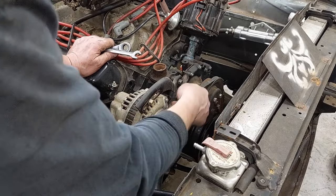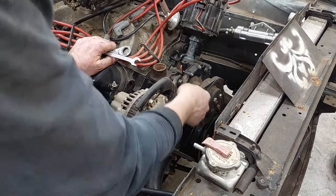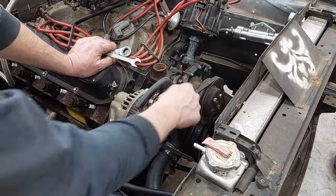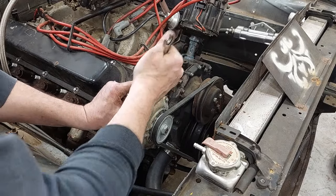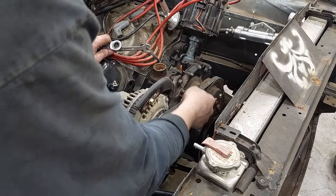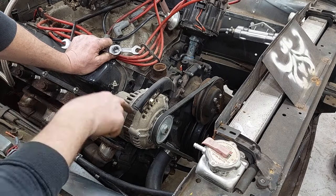It's a little more snug than I like, but the belt turns pretty easy. If you get it too tight you're gonna have a harder time twisting the belt. Being as far out as it is, I may go a little bit looser. Also, if it's a brand new belt it's gonna stretch a little bit. This is not a brand new belt. I don't know if you saw it move there, but it moved on me — that feels nice.